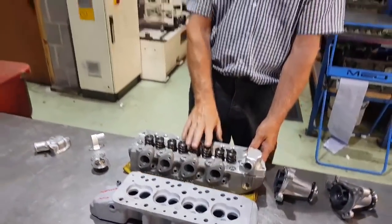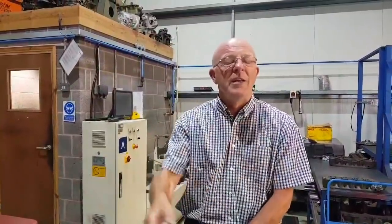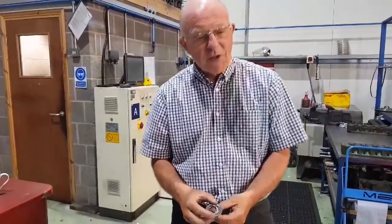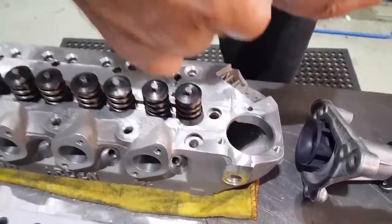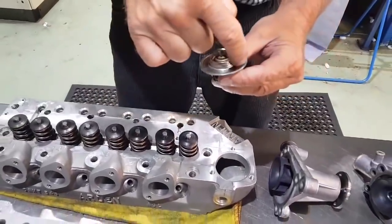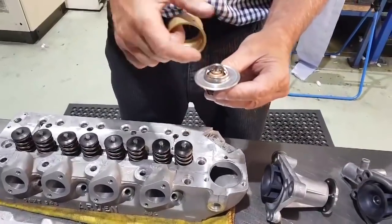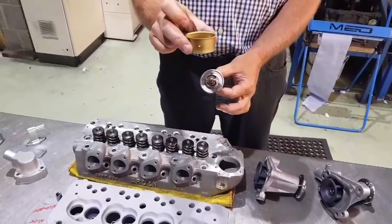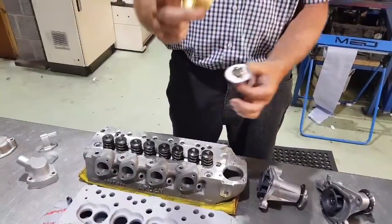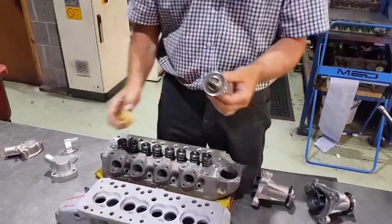This is a race car setup, but you can do it on a road car too. The downside is the engine never gets hot very quickly because the water is constantly moving even before it's up to temperature, so it takes a long while to get hot. What I have seen people do is drill the thermostat — if you take a head off a metro for example that doesn't have a bypass hose, you can do that. What you've got to be careful of is there's a rib, so don't drill very close to the outside edge — three-sixteenths of an inch, perhaps six or eight holes around there, which will do a similar job but not as effective. On a road car I'd sooner see the blanking sleeve than a drilled thermostat.